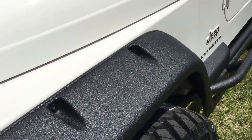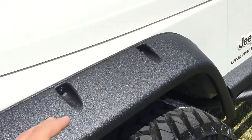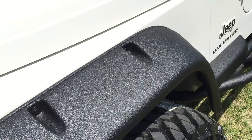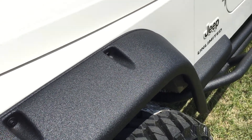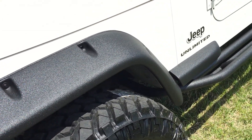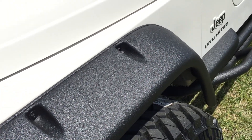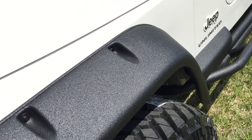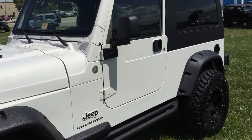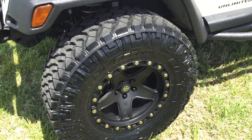Our procedure to do the Linex is very tedious — it's more than just spraying the product on. For all the plastic and metal pieces, we actually sand down with 180 grit sandpaper, then go to 360. From there, we put a surface cleaner prep all over the vehicle, spray a plastic Bulldog adhesive on the material, prime it, and then coat it with the Linex. The whole vehicle is completely covered from overspray. Your end result is a material that's absolutely gorgeous, done right, and looks phenomenal.